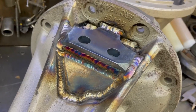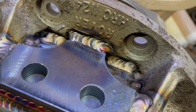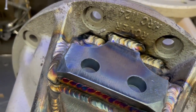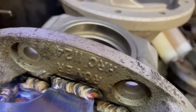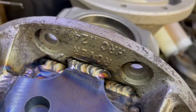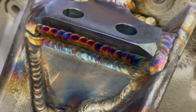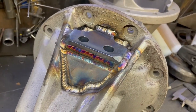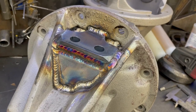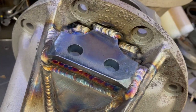This is now finished. We've welded it across the back — you can see the bottom plate welds — welded down the sides and welded across the front. On these casings this piece at the back can vary quite considerably; we've had to trim about 2mm off this to make it all fit up at the front. That is your standard metric casing pegged.